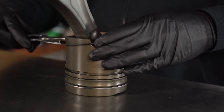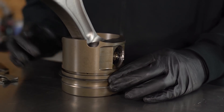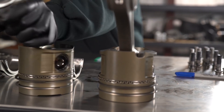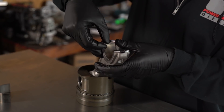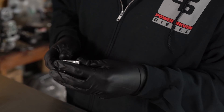Pistons, pins, and rods are mated together. Now it's time to put piston rings on the pistons. The bearings we're using in this engine build are the Clevite H-bearing series. I've used these for a long time and had real good luck with them. All the ones in this engine are their extra clearance version — they give you an extra thousandth of an inch of clearance. That opens up our tolerances a little bit, and in a high performance motor this makes a lot of sense.